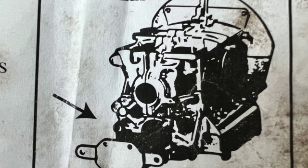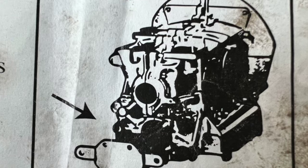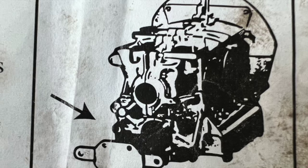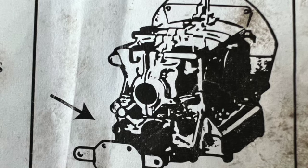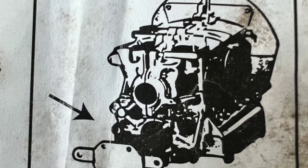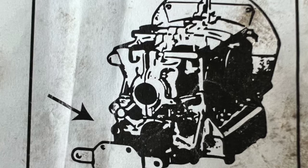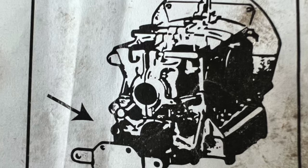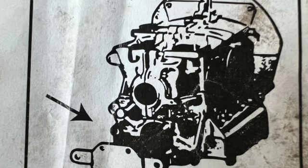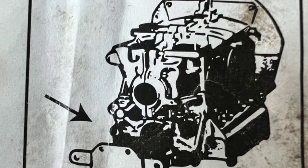However, I tell you this, if you have an engine block like the one that I have, which the serial number starts with Alpha Echo 491 and so on, you're only providing one strong fastening point to your mustache bar. I really wouldn't recommend anybody to do that. That's my personal opinion, and that's why in my case I'm going to stop here and not finish the installation of this EMPI kit adapter, because I really don't see that is going to be a good thing for me.